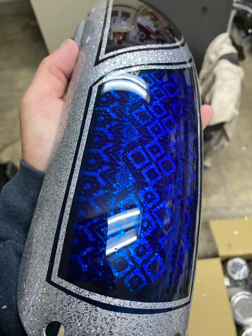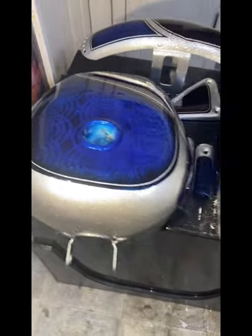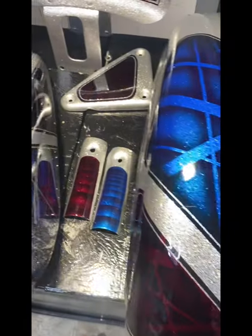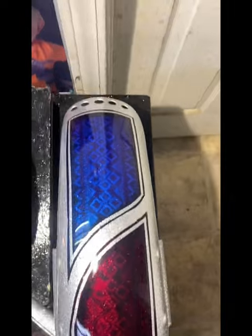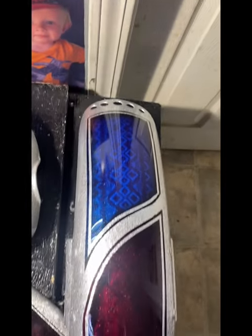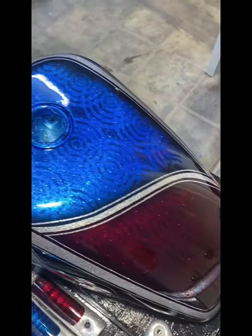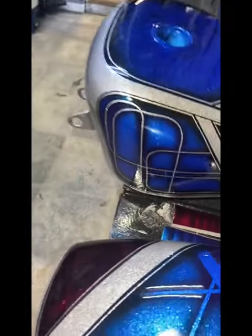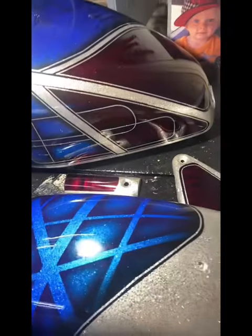Then this is the fender, another tank, other fender, side pieces — this has all had three coats of clear sprayed on it, so it's still going to be nice and shiny here. Looks pretty good, but it's not perfect. After this it will be color sanded, buffed, and polished, so it's super shiny and gives it a little more depth.